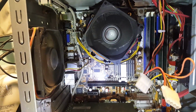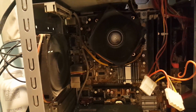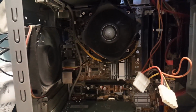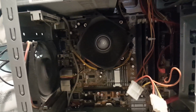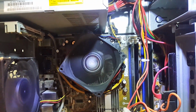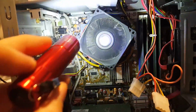What I'm going to do is finish backing up her files that were put back on here for her, and then I'm going to install Windows Vista temporarily. The reason I'm doing that is to update the BIOS, so that it's got the latest BIOS in there. It looks like there was some kind of fan issue in the last BIOS that it fixes, and I want to make sure everything's up to date. Make sure that the Q9650 is actually going to work in here.